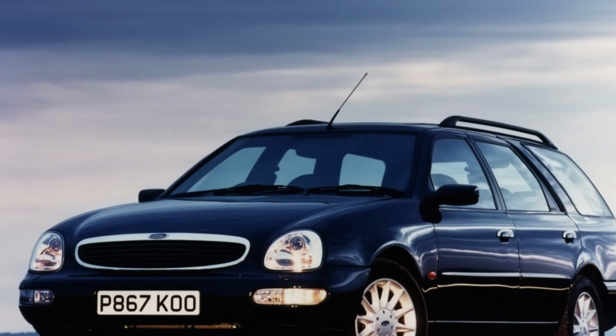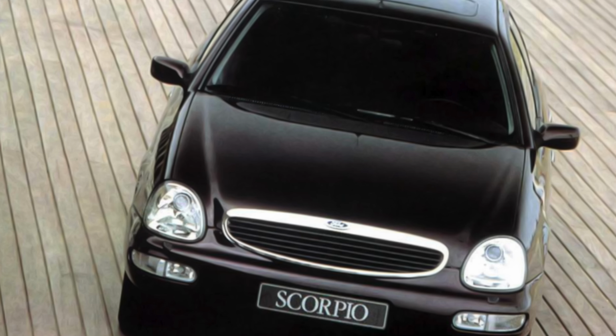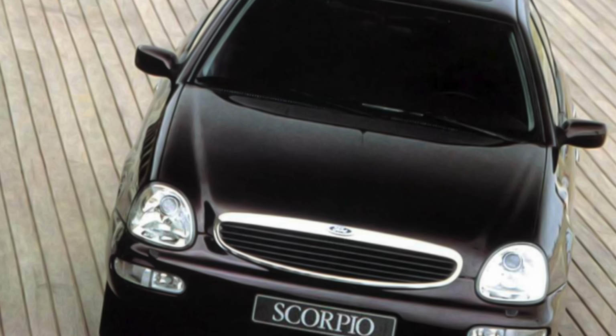The chassis of the Scorpio is tuned for comfort. The car just floats over bumps. Simple, real McPherson struts were installed on the front axle of the first generation car. The wheel in the transverse direction was leveled by a simple lever connected to the anti-roll bar.